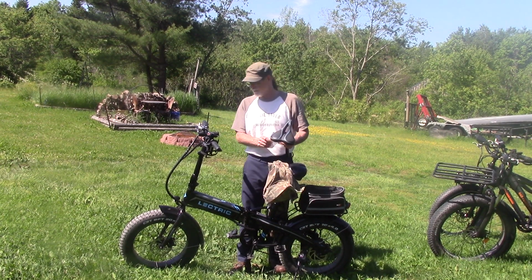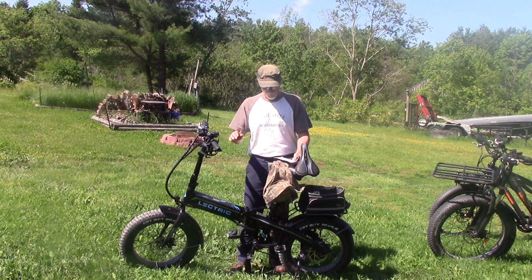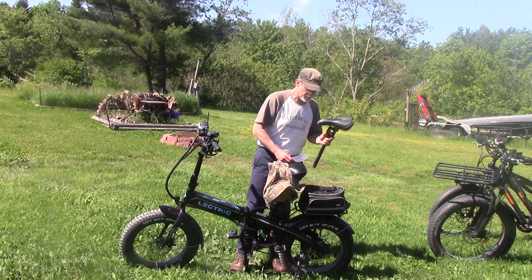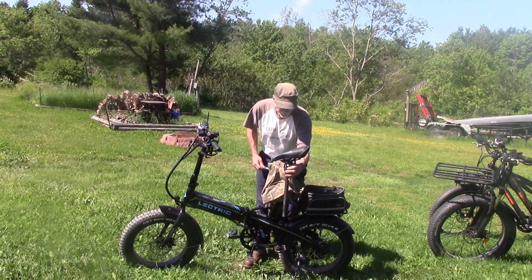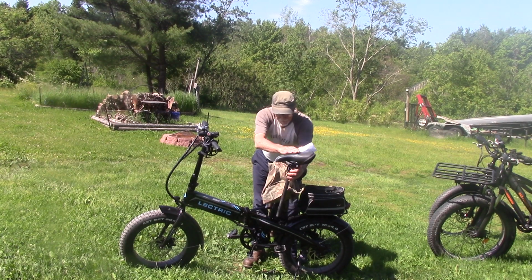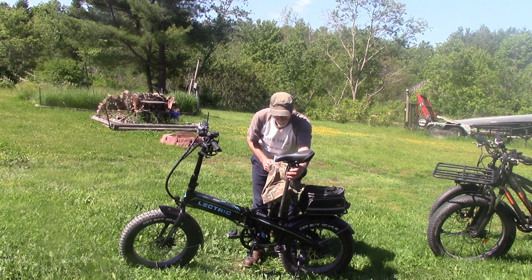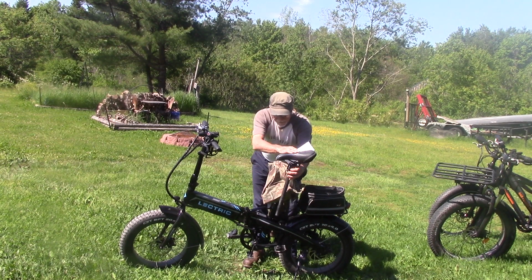I would lower my handlebars a little bit so that I'm leaning a little bit more forward, and we'll get into that also right here. Notice how the nose of my seat is tilted down. See that? If I were to put a level in there, I have a negative angle, don't I? It's not flat, is it? All right, so it's just slightly negative.